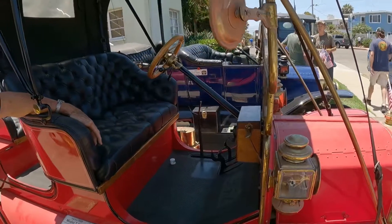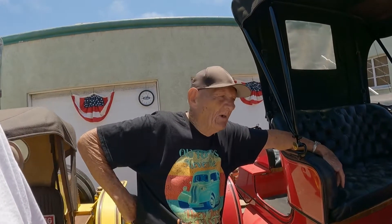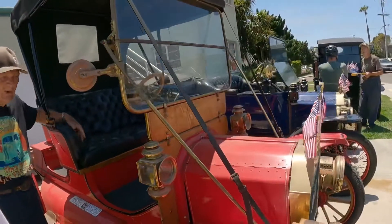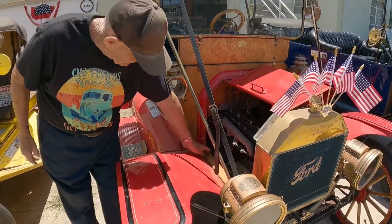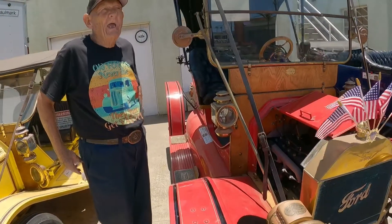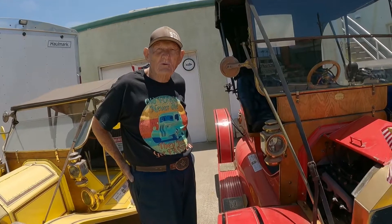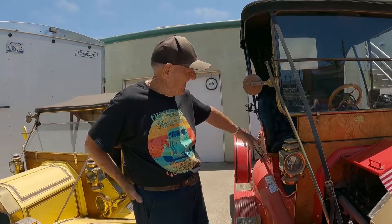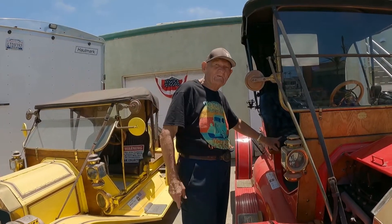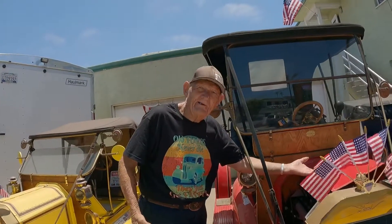There's a lot of engine adjustments. Like if you're going to Pikes Peak or something and your air pressure changes, you reach over and probably richen it up a bit to go up the hill. Did these drive up Pikes Peak? They don't have any pumps on them — gravity flow on the fuel. The carburetor is down here. You probably heard the story about backing up the hill. Not quite true — but if I'm going up a pretty steep hill and I'm not fairly full of gas, the gas won't flow from the gas tank up to the carburetor. If I turn around, I can back uphill because the tank then becomes higher than the carburetor. Had nothing to do with the power — just keeping the gas flowing.